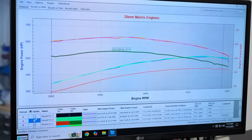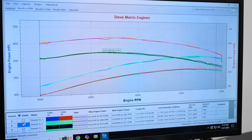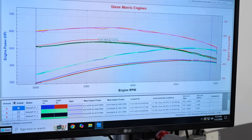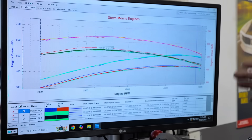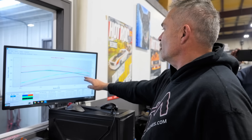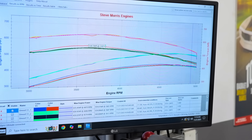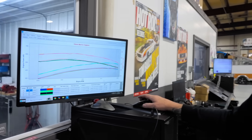All initial testing was done on one ignition — we thought it was just a little down on power, no problem. Then we hooked up the A ignition and bang, it picked up 100 horsepower and it repeats — keeps coming back to exactly the same numbers. Every A ignition pass, every B ignition pass overlaid — fascinating. Leave your comments on why that is. The back spark plug position is clearly better; there's something going on in the combustion chamber that we have to think about.